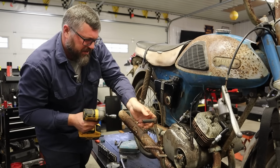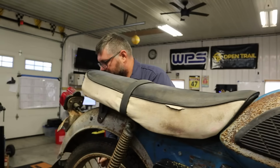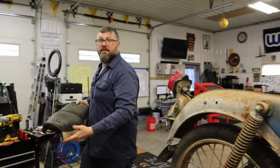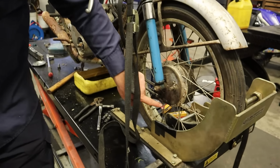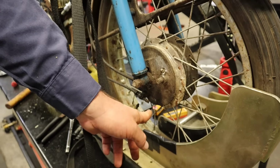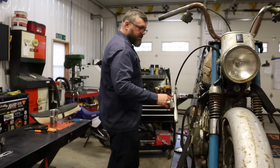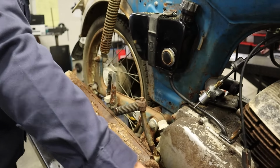Don't let it get you. That thing doesn't even, that's just rusted in place there. The throttle cable's just gonna pull apart. What else is gonna pull apart? Right. You definitely don't have brakes on this bike. I think I have rears, but I don't have fronts for sure. Really? Because, yeah, look, this cable here broke. There's supposed to be an arm coming from here, I believe. Then that cable pulls that arm, and stop. But the cable's broke and the arm's missing, so. But look at this, look, watch. Rear brakes work.